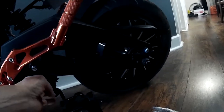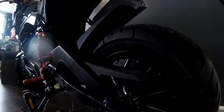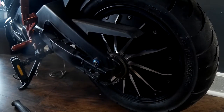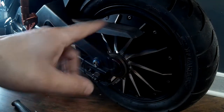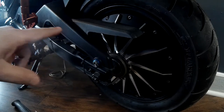What I ended up doing is I ended up taking off the chain, which is a bad idea. I'm going to show you how to do a quick mod where you can fasten this where it's not dragging and you can leave the chain on and it will freewheel in both directions, which is basically what you want to keep it legal. It's got to have pedals, sticker, chain.